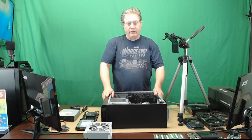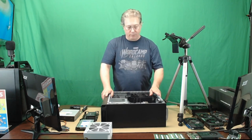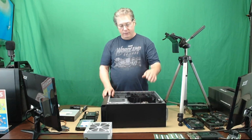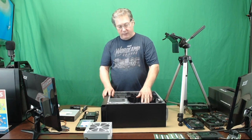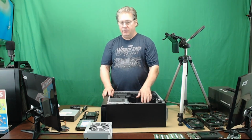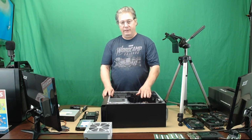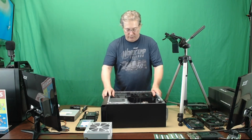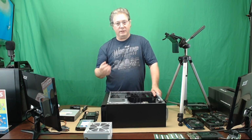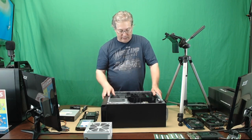So a few things that I've already done to prepare. You can find videos for these online. Perhaps I'll do a couple in the future, but today I'm just trying to save a little time. So whenever I get a new computer, if it's an older computer, one of the first things I like to do is pull the cooler out and replace the thermal paste, especially on an older computer. It's really a good idea to do that. It's usually dried, and you're not going to get optimal performance out of your CPU. That's especially important when we're talking about an older computer, which is already a little bit slower than most of your newer computers. Not all of them, but so I said, okay, we're going to do that.